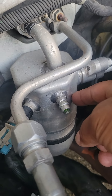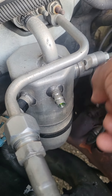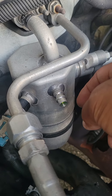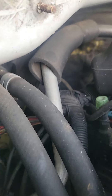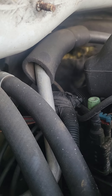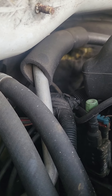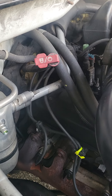For those of you with old receiver and dryers that are rusted, check behind it, check on the side of it, check beneath it. My experience has been you can have a leak anywhere on this puppy. See this AC line here? Follow it — notice that it goes back against the firewall and is encased in some sort of rubber hose. My experience has been you could have a leak back behind or inside that rubber hose and never know it. So check everywhere.